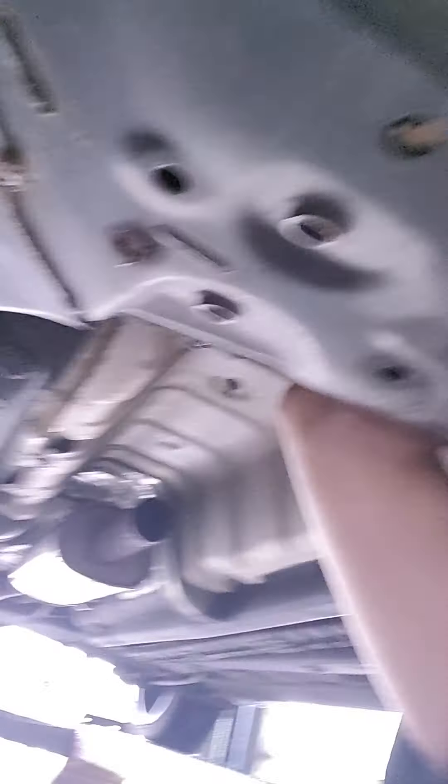The ten dollar CEL fix created fifteen hundred dollars more worth of repairs for the catalytic converters, not including the underlying problem with the car — it needs a GDI service, probably a tune-up, and who knows what else. We're going to dig into it, put a good catalytic converter on here, replace the downstream O2 sensor, and keep moving. Ten dollar CEL fix sometimes only creates more problems if you don't know what you're doing. This car was sent from one of our dealerships for us to resolve. Thanks for watching.